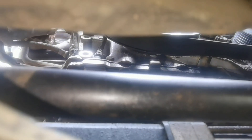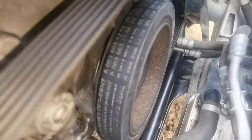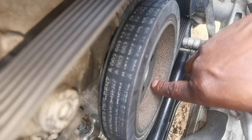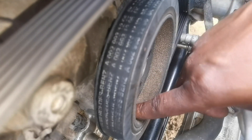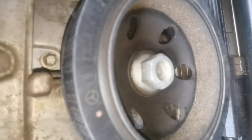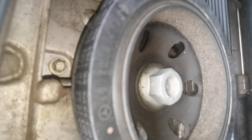I would say that is our culprit — definitely engine oil. Looking at it from the top at the crank pulley, you can see there's a layer of dust sticking to some oil, which indicates the seal is leaking. That's why there's oil on the crank pulley and this buildup of dust mixed with oil. The pulley bolt is actually oily as well. I'm definitely sold — that is our issue right there, although there's quite a lot of oil.